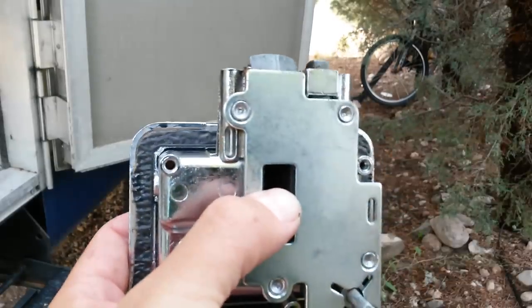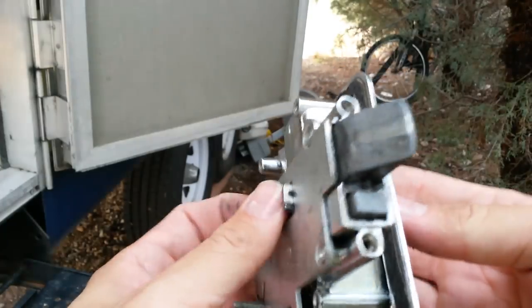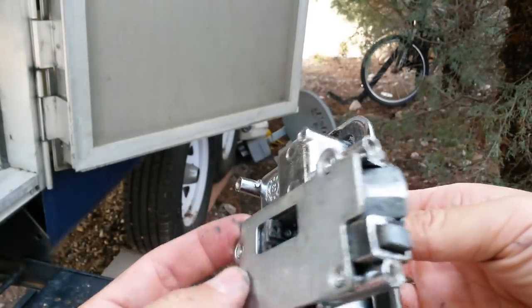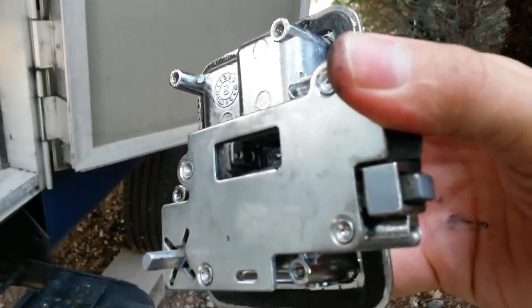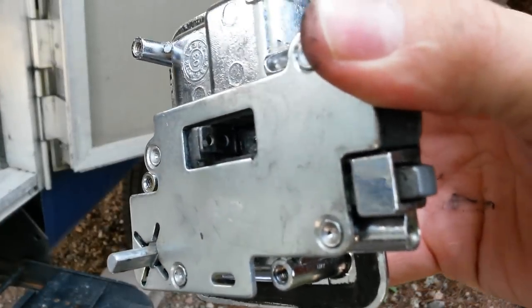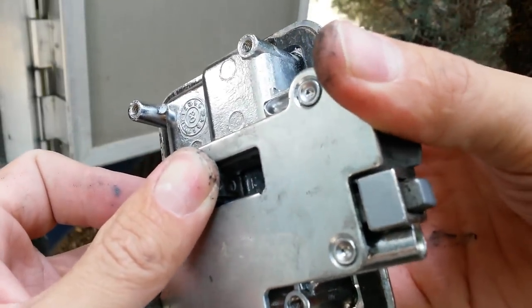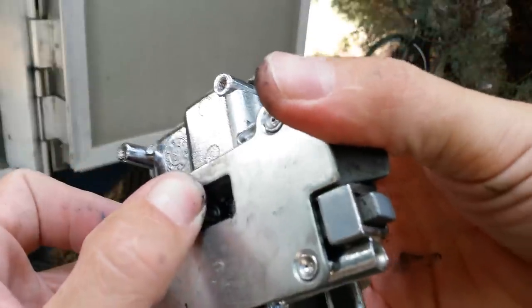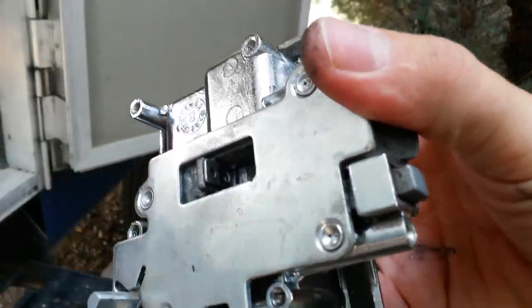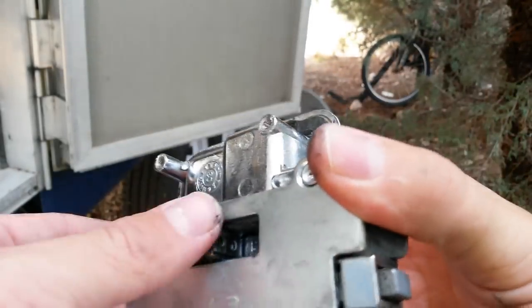The way it's going to sit is just like this. It sits on there like that, and the bevel part actually catches the handle on the inside. You can kind of see it hitting the bottom of the bevel there. That's where the little piece of broken-off aluminum was, and when that broke off, it rendered the door pretty much useless unless it's opened and reset from the inside.